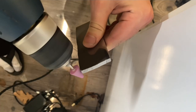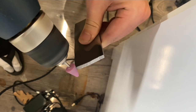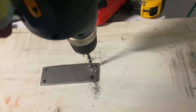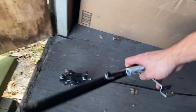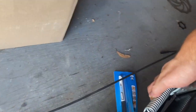I went and cut out my kickstand piece and then hit it with some polish because the edges are sharp. Now I'm drilling the holes — it helps to get a piece of wood in the back. Make sure to use titanium or cobalt drill bits so they can cut through that steel. Here's our kickstand — we're just going to mount that on there.